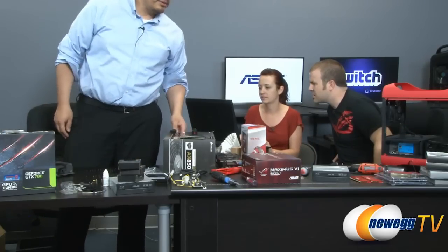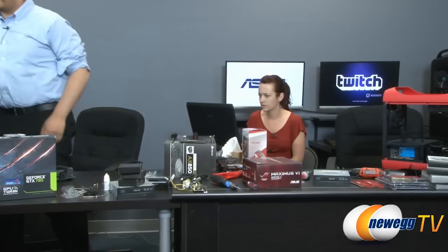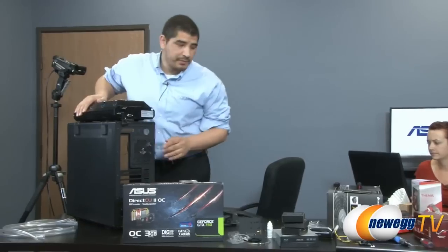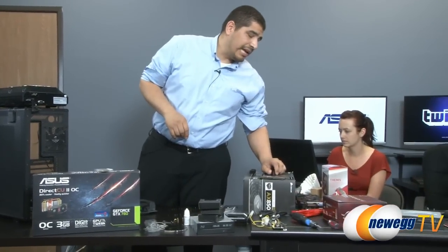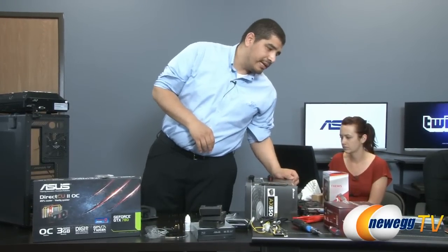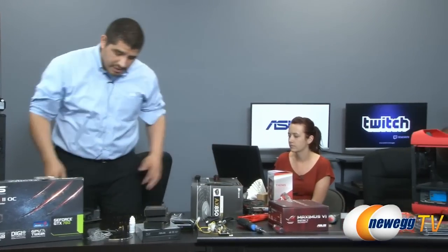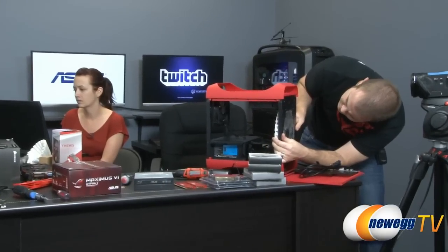Stuttering could be really a lot of different things. What I will say is, in my experience, one of the most common things that a lot of users forget to do is install primary drivers, like their chipset driver and their SATA drivers. This can impact system stability sometimes, so it's something you would want to check on. Another thing that a lot of people don't ever use, and it's part of the Windows operating system, is the problem tool and the performance and reliability monitor. You can actually track your system's reliability over time, and it can sometimes give you a lot of insight into where your system may be having problems. So I would recommend taking a look at that, as well as making sure you have your chipset drivers and your SATA drivers installed.